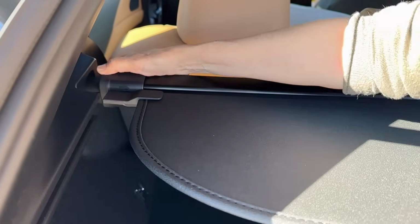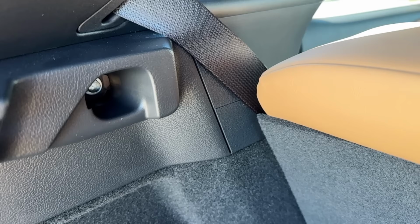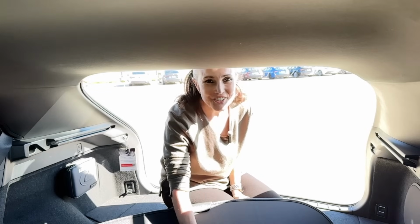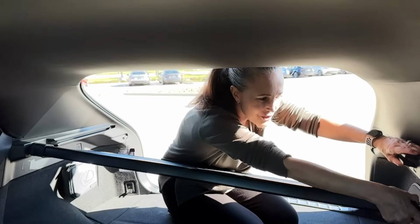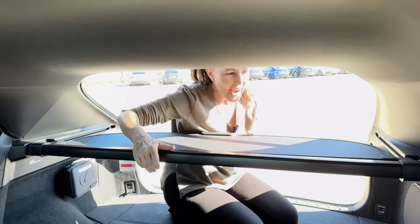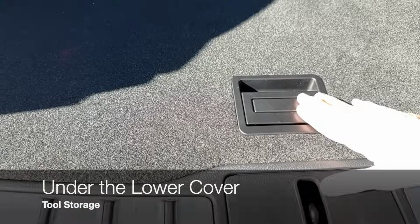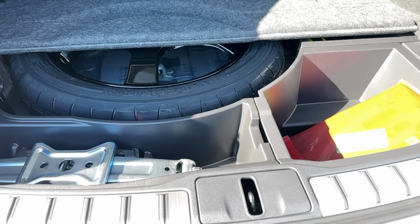and then you'll notice that there's a slanted section of the mounting opening. You can gently take that down and then make sure to support the other side, because now it's going to just easily come right out for you. When you're ready to put it back, you'll just do the opposite. Put one section in, make sure to squeeze the tension rod to work it into the opening on each side. Rotate it flat, then slide the tabs that support the shade back into the track on both sides, and you're all set.